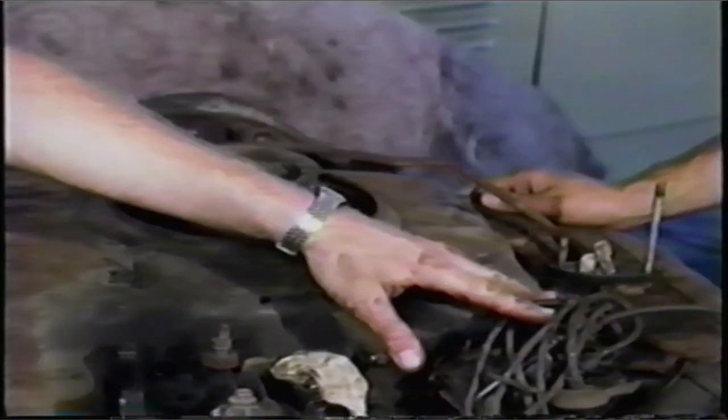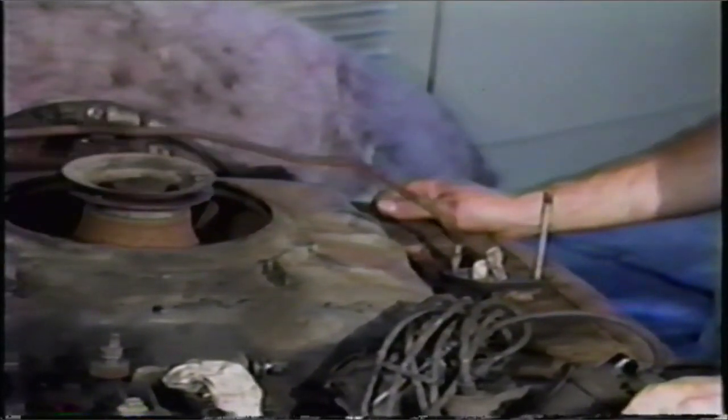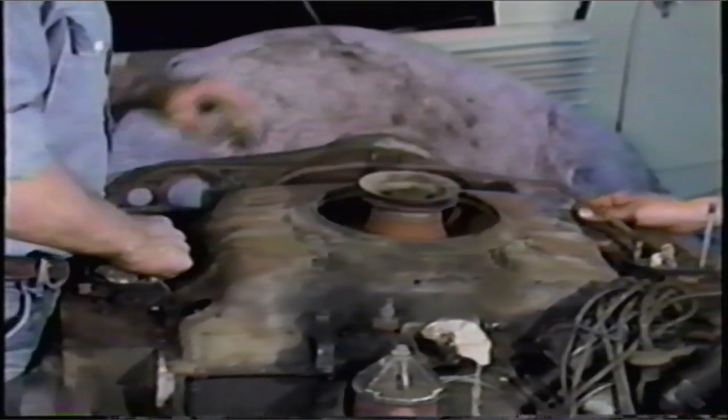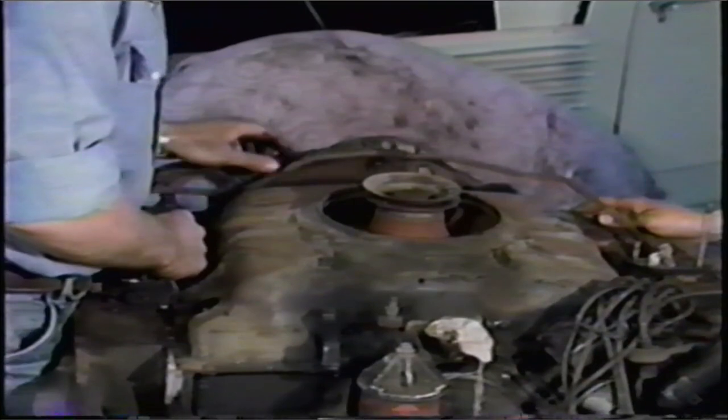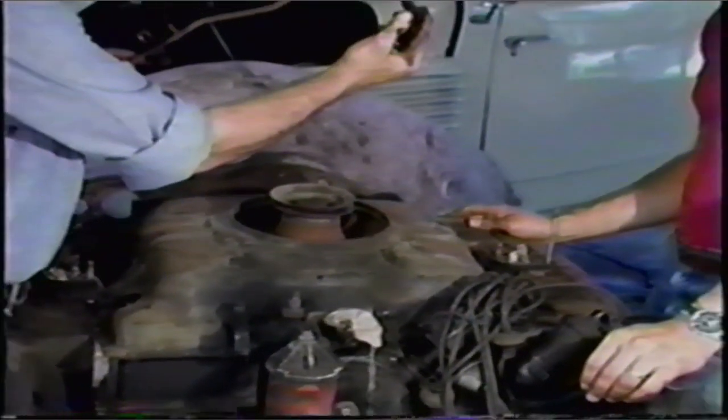The way this car is made is actually two independent engines operating here. The only thing they really have in common is the oil system and the ignition system — the carburetor system is really entirely independent from one side to the other. The engine will run on one carburetor — it won't run well, but it can do it. This tube helps connect the two sides of the engine together and even out the intake of air and gasoline. It also provides a very handy vacuum source for accessory units, automatic transmission takeoffs, etc. This tube is held on by two little pieces of rubber hose with no clamps. They're usually very brittle and are a source of air leaks that make it very difficult to tune your car, so these things usually get replaced.